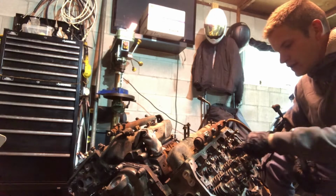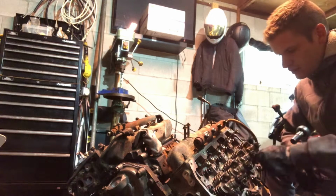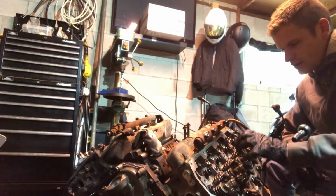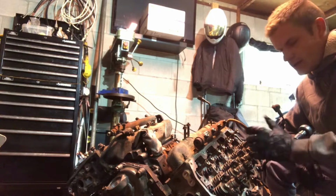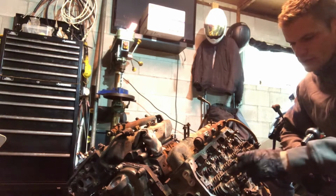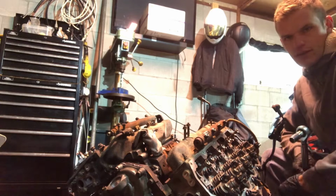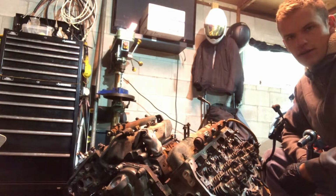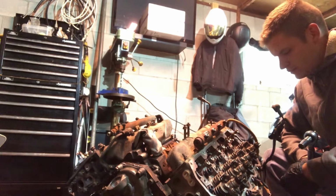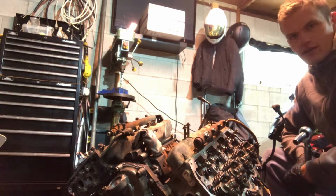So it's about $1,000 at least for that product, but that's the only thing that was missing. It looks like it could create some more increased strength and make this more rigid in this area, having the head studs and the bolts a separate unit. But if you are just not planning on putting a lot of power, bigger turbo, injectors and stuff like that, and just a bit of power over stock, then reusing your old head bolts, something that I have done, works. We'll see how long it lasts, but it should last as long as head studs like this would last.